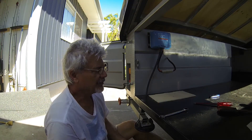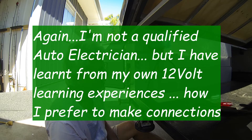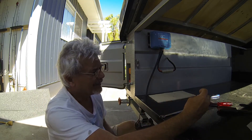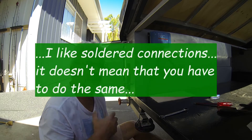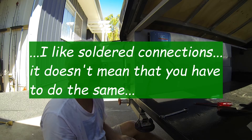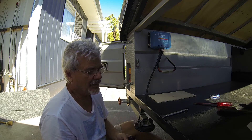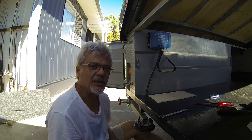I'm not a qualified auto electrician or anything like that, but I have learnt over the years of playing around with 12-volt stuff that it's generally a logical process. Certainly look at the instructions — they're valuable. Whenever you buy something, ensure that your connections are good. That means you've got to use soldered connections and heat shrink to protect them from the elements, as well as from inadvertent grounding out against something and creating sparks. That's something you don't want to do.